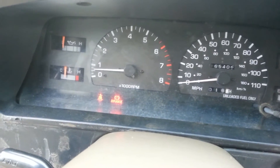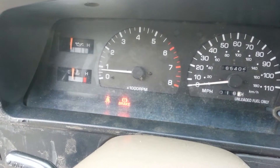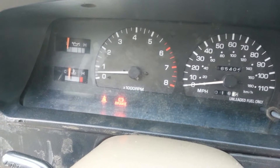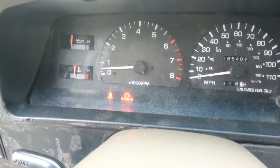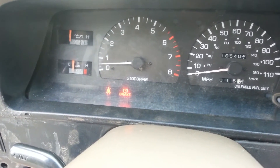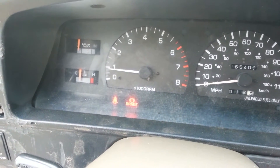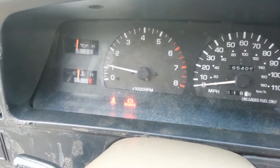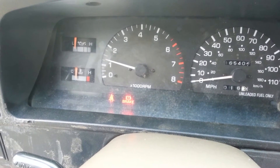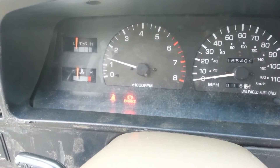The resistance in this one affects idle about a thousand RPM. Right here it's completely off — nothing happening. Basically the same signal gets from the sensor to the ECU. You crank it up and you modify that signal. And basically that right there is open loop, running like it would if the engine were cold.